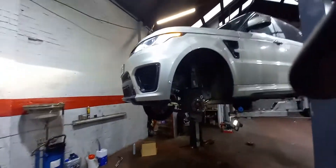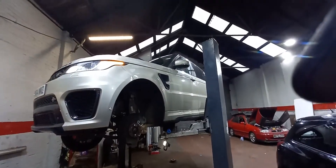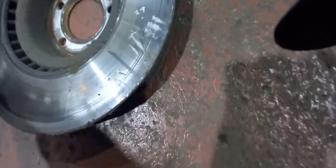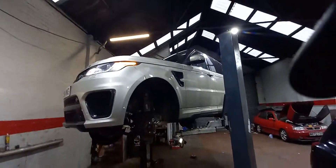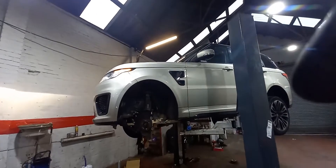We really have been fighting with this calliper to get the middle piston back on the inner side, which we didn't know about. It's come from another garage and they had found it had a seized calliper on the driver's side, so they couldn't do the pads and discs on it. It's into the metal on that side. This side wasn't there yet, but judging by how tight this calliper was, it wouldn't have been far behind it. You can see with the witness marks and the big lever we have been struggling, but we did get it. I would just recommend on this big Range Rover to get this calliper replaced as soon as possible — just to keep the brakes going. It's better doing the two as a pair anyway, the size of car this is.